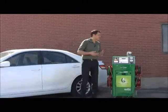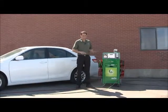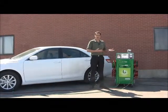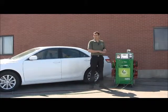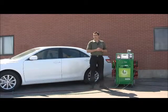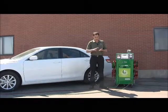Some people ask: air is already 79–80% nitrogen, so what's the difference of another 15–20% in the tires? It's not actually about nitrogen at all. Nitrogen is dry, inert, and non-flammable. It's really about getting the oxygen and the water vapor out. Why do you buy bottled water? You're getting rid of the impurities and contaminants you'd find from a kitchen sink — same thing with nitrogen tire inflation. You get rid of oxygen that escapes faster out of a tire, and you get rid of water vapor that expands and contracts at a greater rate. Your tires will run cooler, you'll get better fuel efficiency from a consistent contact patch on the road, and the tires will last longer.